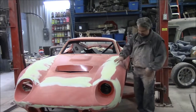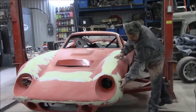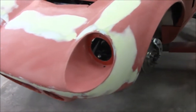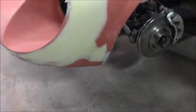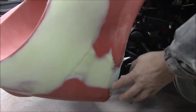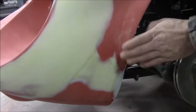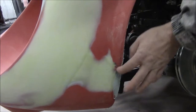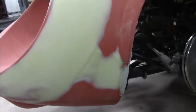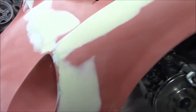On the driver's side front, if you recall, there was a chunk missing — probably from shipping or something done at the factory. So we repaired the fiberglass behind it. There's a little gob of body filler on there now just to fill in a couple of air pockets or bubbles. We'll sand that out next. That section has had all new fiberglass matting put in.